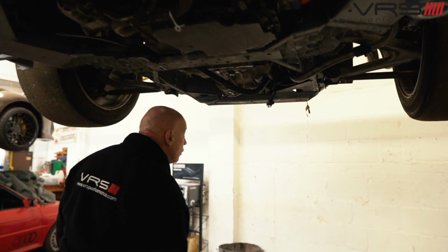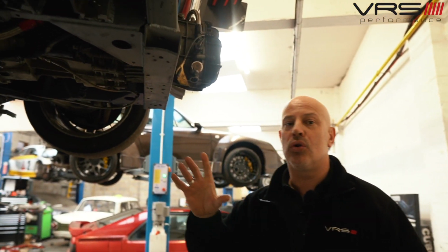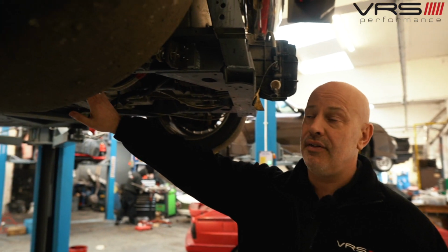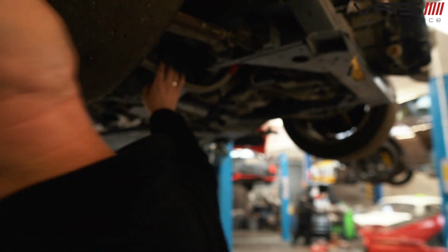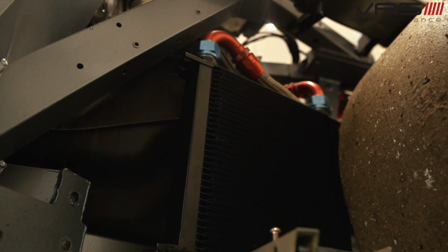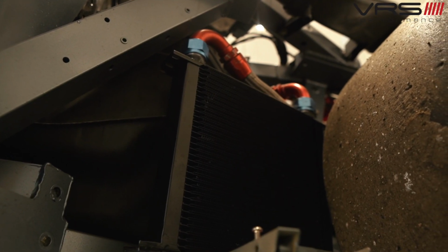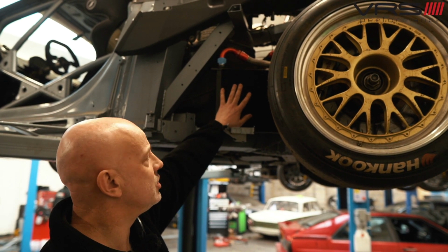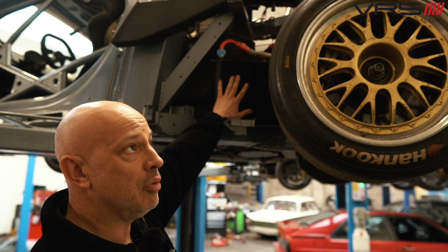And it also has oil coolers for the gearbox and for the engine. Normally this will have an oil cooler which is basically cooled by the water system, except this time it's got a big Setrab cooler here, which is going to be remounted. We're going to repipe it as well with some different pipe work, just because this is old. And we'll clean this oil cooler out, make sure it's got no shrapnel inside it. If not, then we'll replace it.